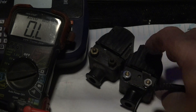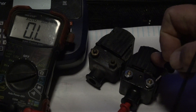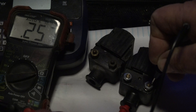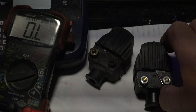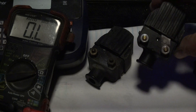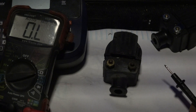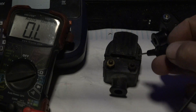I'm putting the positive probe in the ignition cable outlet and the negative on the negative contact of the coil, and it shows 257 ohms. Strangely, all six coils I had on the engine look pretty good, but they're definitely aftermarket coils and they all show the exact same value. Here I have an older coil from a spare motor.